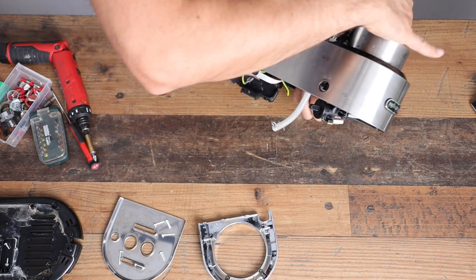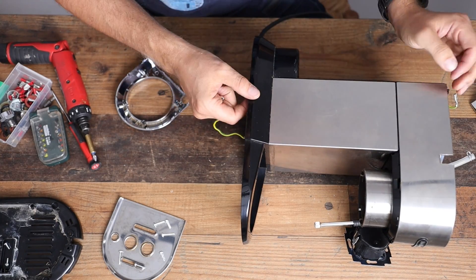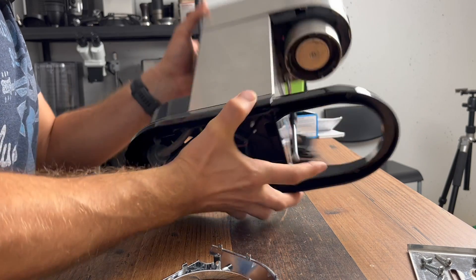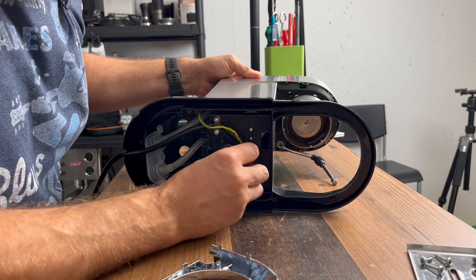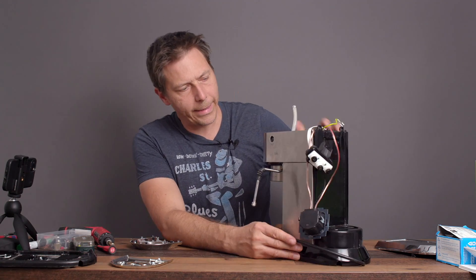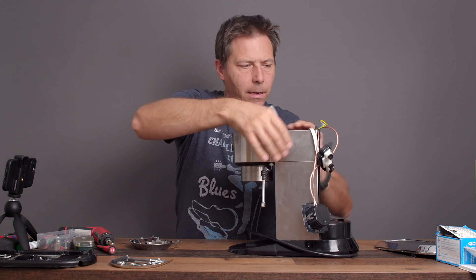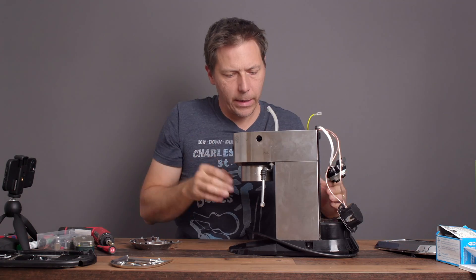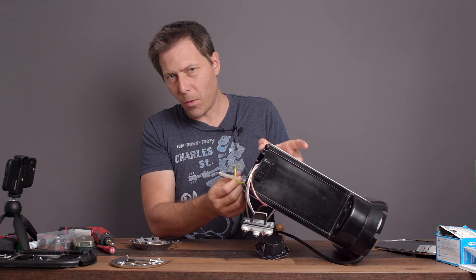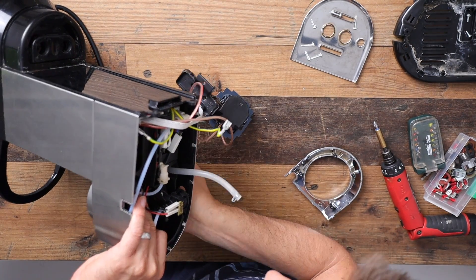I got this on the wrong side. Now one of the important things I've got to do before I forget is attach this ground wire — not that easy to videotape, so just bear with me. One thing to keep in mind is you need to make sure that this knob comes out directly through this hole — if it doesn't, then the cartridge isn't completely seated where it needs to go. I've got to get this back through the hole properly, just going to jiggle it until I get that little clamp holder through there.